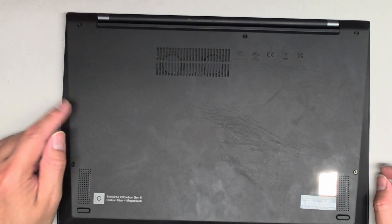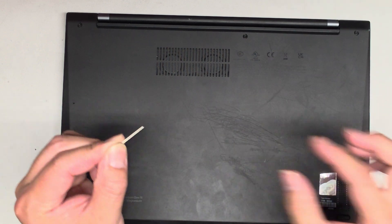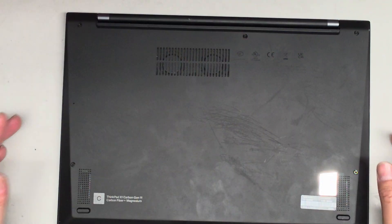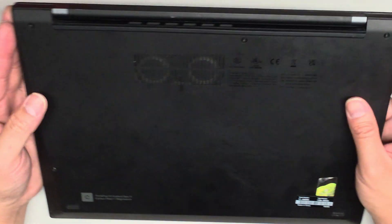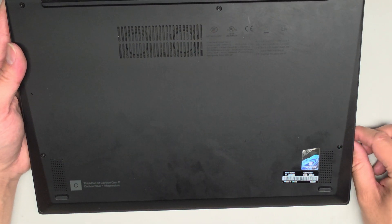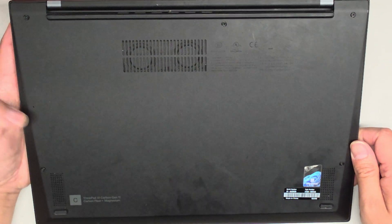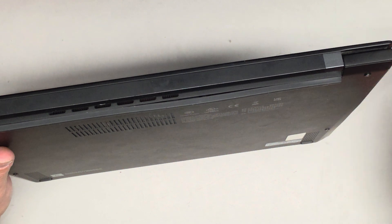There's also a little hole here for a battery reset. You can use a little pin, a SIM eject tool that's long enough, a needle, or a small folded-out paper clip — whatever works to push into that hole. You'll feel it click. Press and hold for about 15 seconds and that will do a reset. If you're having some issues, give that a try — it could save you.